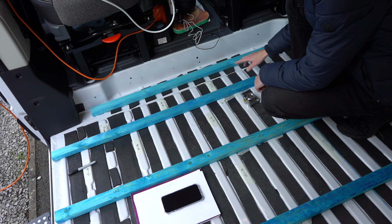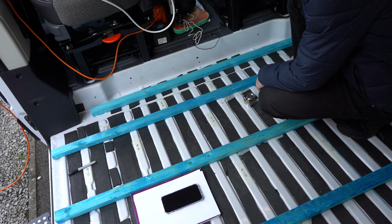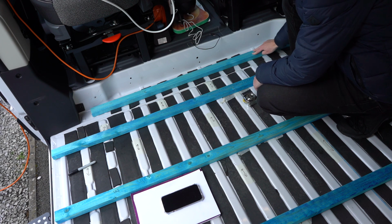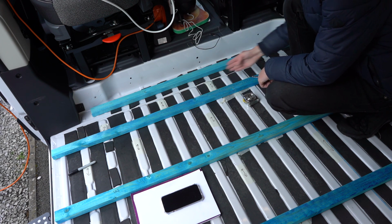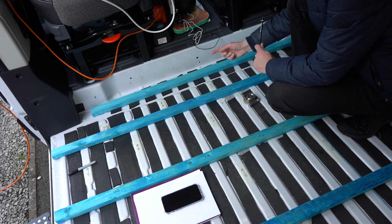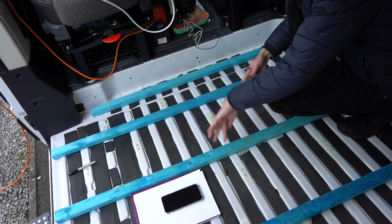Next is to start the lengthways battens, so just making sure that this one is going exactly where I need it to be, as is this one, and then I can measure the distance here and then create, I'm probably going to do 4 of those, all the same length, nice and easy. So I'll chop those, get those fitted, and then start working back that way, so that in case there's any discrepancies, I can always adjust back as I go.